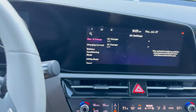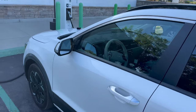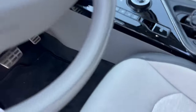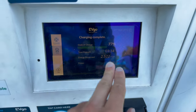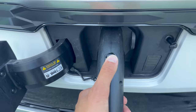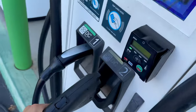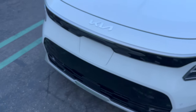That's the basics of charging. When you're done, make sure the vehicle is off, then end your charge session on the charger before you unplug. On this EVgo unit there's a stop session button on the touch screen. You'll hear a clicking sound from the connector. Once the session is ended and it's confirmed complete, press the button on the handle, remove it, and return it to the stall. Make sure you close everything when you're done. By the way, with electric cars you can lock them and walk away while charging.